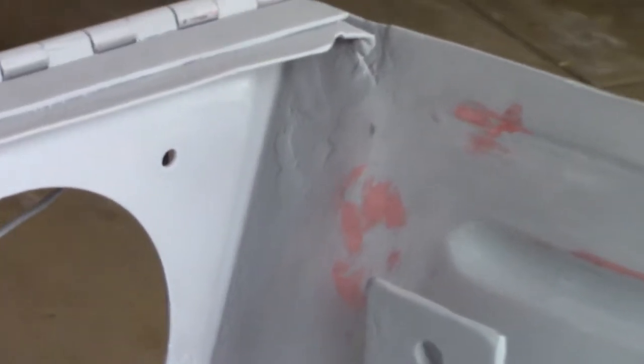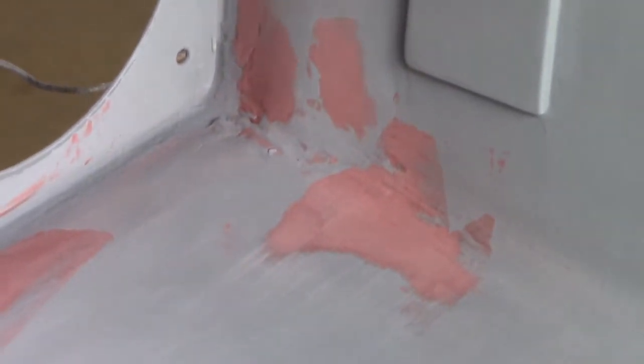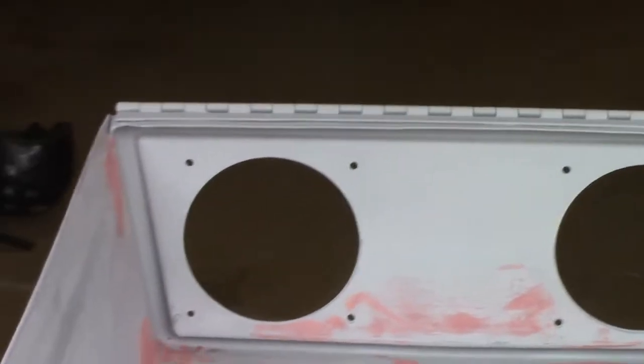Here's what I'm trying to smooth out — you can see back in there where there were welds, I've got a lot of body filler in there smoothing it out. I don't know why I'm taking this much time; I mean, this is the inside of it. But I just can't not be a perfectionist. Along here too there are a couple of places with still a little pitting, and you can see me filling the pits with glazing putty — it's probably a waste of time, but for some reason I just can't know about it and not try to get it as good as possible.